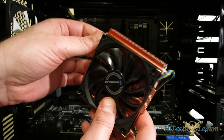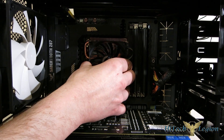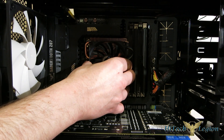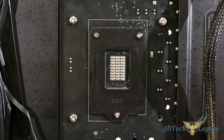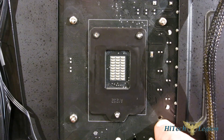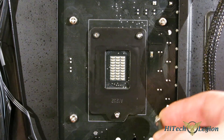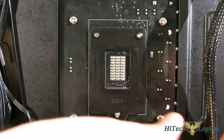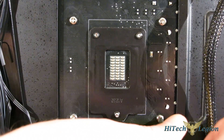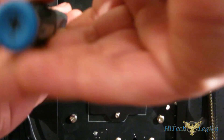Never upside down. So we're going to put it into place, and simply put the four screws in from the rear. On the back of the motherboard, as you can see, the four screws go in, and when you're threading, it's actually very easy to see the threading through the hole in the motherboard. Just get your screw right into place — it's not something you really need to fidget around with a whole lot, especially once the first screw is started. The four will go right in. After you've got them hand tight, tighten up in an X pattern until they stop.